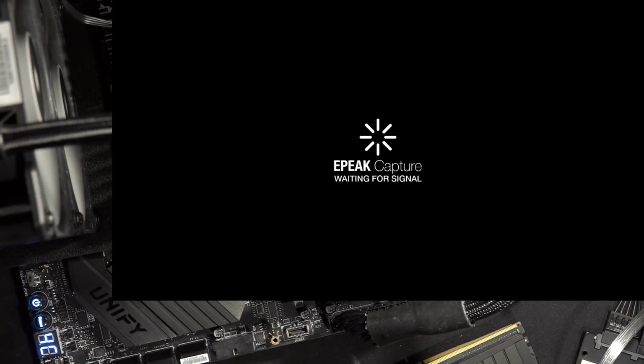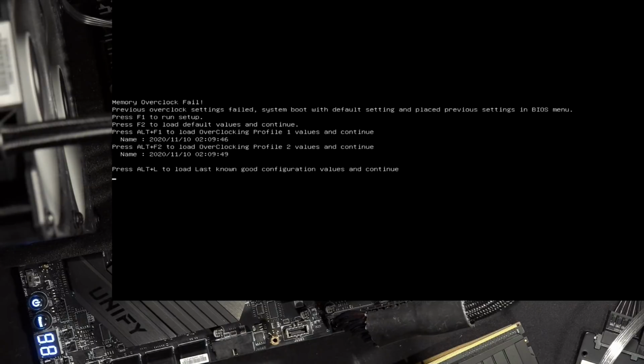And it's 55ing. So when it spits out 55, that's the memory controller complaining about settings. It's very, very upset with me. I think we just hit the auto recovery at this point. We're going to get an overclocking failed message, aren't we? Yeah, so overclocking failed. So 4533 doesn't even boot.